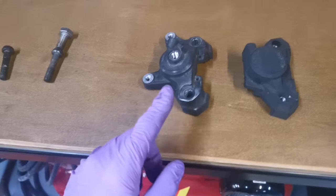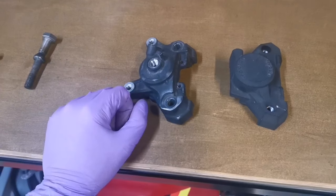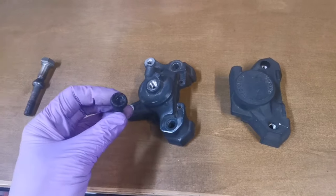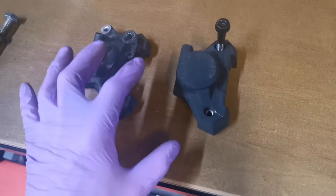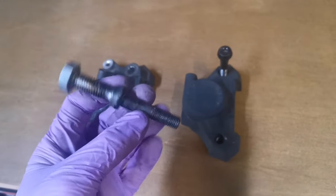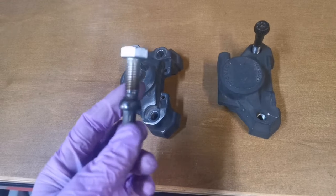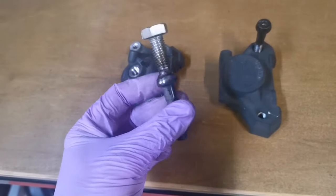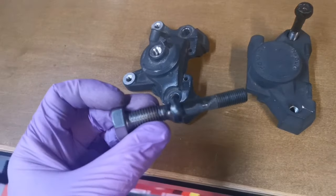All right. Okay, so I've got a problem, but I've also got a solution, and I'm going to show you what the solution is to the problem. Now, I'm rebuilding these brake calipers, but I have a problem. I've had several problems with these, with stuff being seized and having to be heated up and removed and welded to remove things. So I've not got any replacements to these retaining bolts which fasten both calipers together. As you may have seen, this one was heavily seized in. The only way of getting it out was welding another bolt to it, thus introducing some heat will help this to expand and release this seized bolt. But now this bolt would appear useless, but I've got a solution for that.